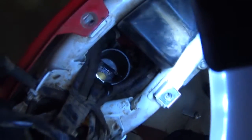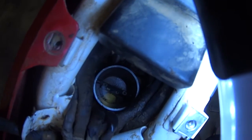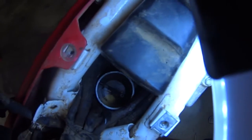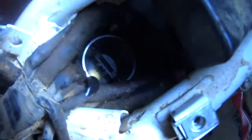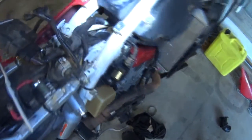We can see a couple of little bits of dirt that we missed. I'll put a bit of grease on a screwdriver and pick those up with the tip before we seal it up again. We did find that there was a small hole in the air filter — that might be where that dust is from. It's also a mix of oil. So that's the butterfly out. Now it's just a matter of reassembling carefully after we've cleaned out.